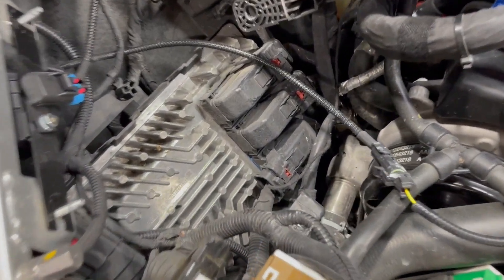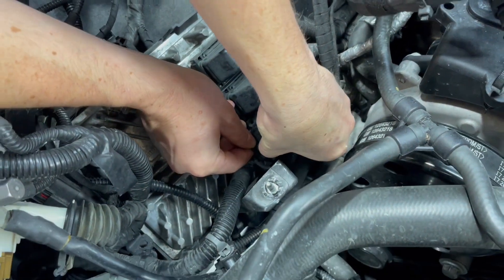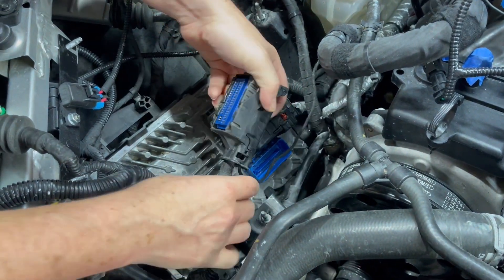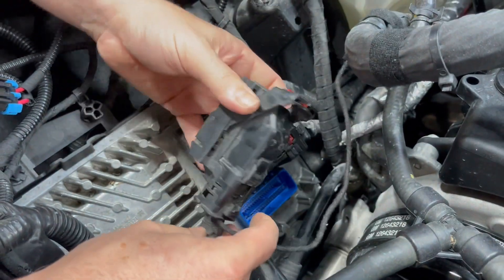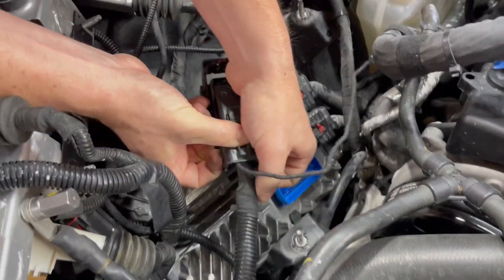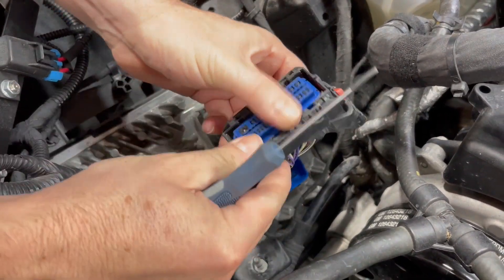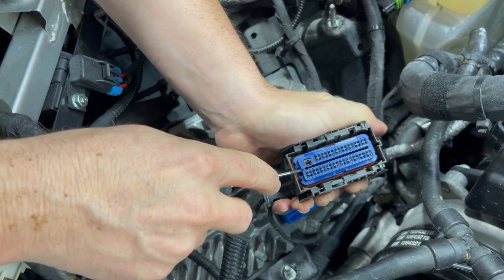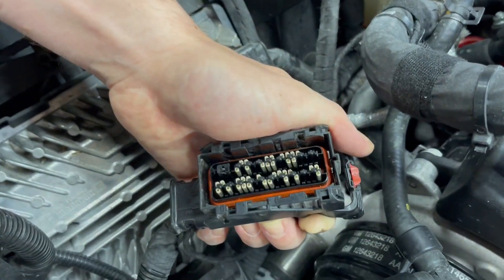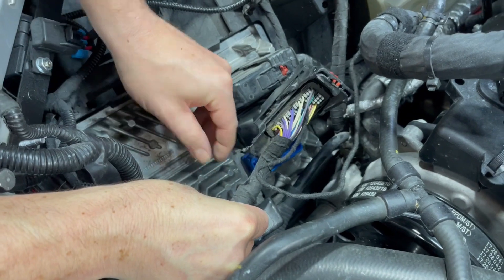We can make our three connections to the X1 and X2 connectors. We pushed a couple of wires out of the way and we're going to start with the X1 connector, which in this particular case is the furthest down connector. This X1 connector will have the blue insert inside of it — a blue connector and a blue insert, so that's the one we're looking for. This vehicle already has a flex fuel sensor connected to it. We'll go ahead and take the cap off of this. We're going to look for pin 39 and pin 40. We'll remove the release on the end. Before we pull those pins out though, we have to open up this harness to get ourselves enough length.